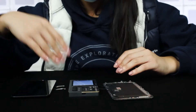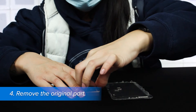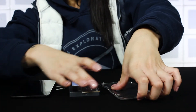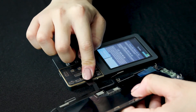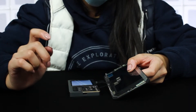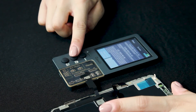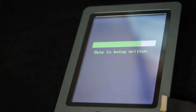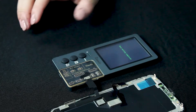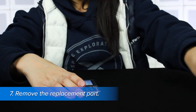It's going to duplicate the parts data over to the iCopy. Next, remove the original part and connect the replacement to the iCopy. Once that's connected, go ahead and press the right button, which is going to be the third button down, to transfer the saved data over to the new part. Once that's done, go ahead and remove the connectors. And that's it. Pretty easy.